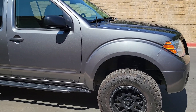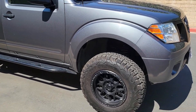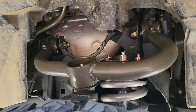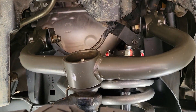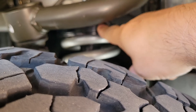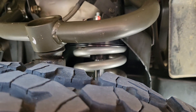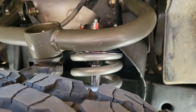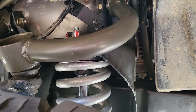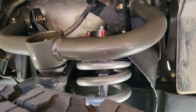I just did a thing — got a suspension upgrade. I got All Dog Off-Road upper control arms and a 1-inch spacer to put on top of the Rad Flows. The Rad Flows are 2.5 but I basically have them set at about two and a quarter, so I'm running actually a three and a quarter inch lift up front.